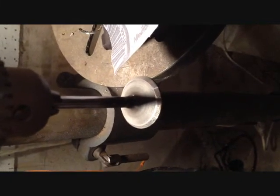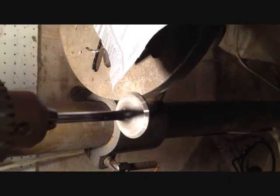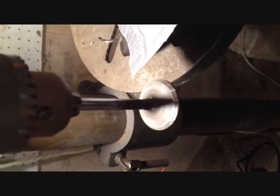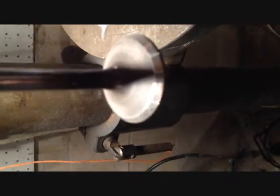I'm doing it because A, I'm right here, B, it just annoys me when I do a leak down check and it's leaking past the exhaust valves. I'm sick and tired of them. So, instead of running all pitted valves, something's going to be better than nothing. So, this one was really pitted up. You can see I'm mostly done. I don't know if this is going to zoom in very well on the surface. You can see there's still minor pitting.